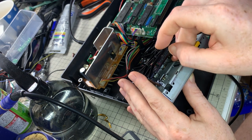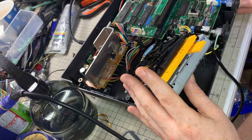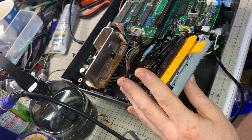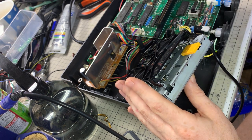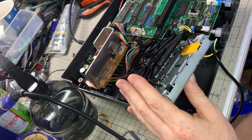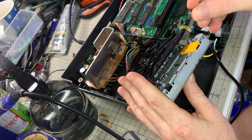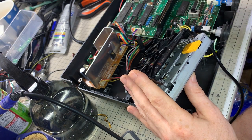You can move it in bigger increments. It kind of speeds things up in a way, but for this video I'm going to do it in smaller increments because it's a more careful approach if someone's watching this for the first time. Generally, as a rule, I like to have the discs reading with the Nintendo message after about 7 or 8 seconds. So I don't really wait for the error 22 to show up. I just count to like 8, and if it's not even loaded into the black screen yet, I just switch it off and adjust it again.